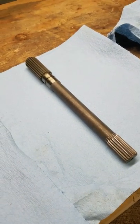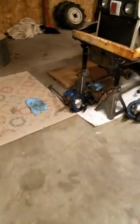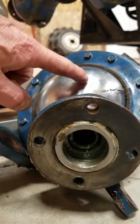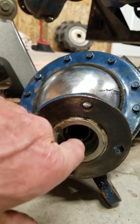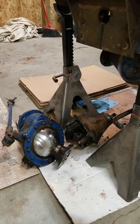That is the culprit. That is the drive shaft from the transfer case to the wheel on the four-wheel drive. I have one side, but the other side was non-existent. What had happened is that the bearing — the bearing that goes inside there with a snap ring — that goes to a U-joint in here, and that shaft goes in there. There was a bearing, the husk of it was left, and the bearing had gone out and chewed up the shaft, and they had not replaced it. Come to find out, parts for this thing are like gold.